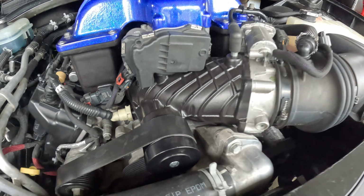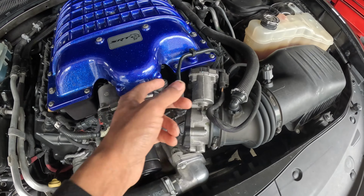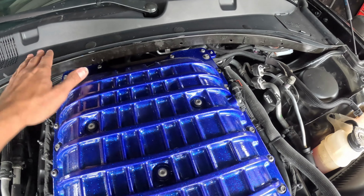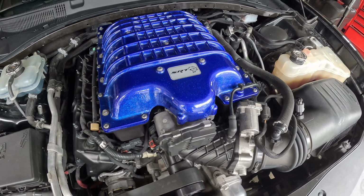So what I'm gonna have to do is take this intake off, unhook all these lines, unhook the injectors, unhook air lines, unhook the map sensors, and take this bar across the top off again when I just put this brand new piece. But I'm new to this car stuff, and I guess this is what happens. I'm just not having very good luck lately.